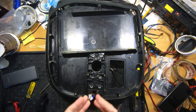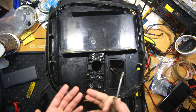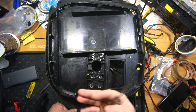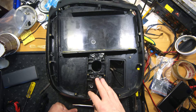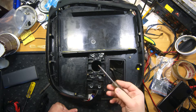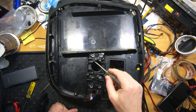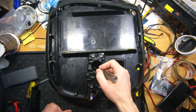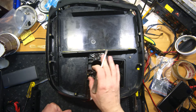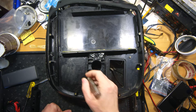Here is how the reinforcement of the inner shell looks. I used a not-very-sharp screwdriver to remove the excess melted plastic from the screw holes — it became a soft substance, the true result of the thread locker reacting with the inner shell plastic. I've added 3mm more of plastic on this side, closed the big holes so the dimension is now only for the nut, which gives additional rigidity. I've also closed all the reinforcement ribs with plastic on both sides.